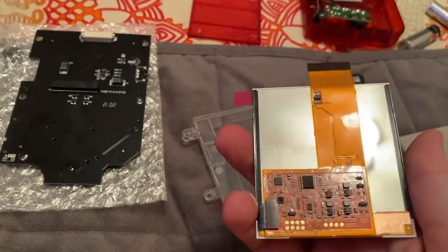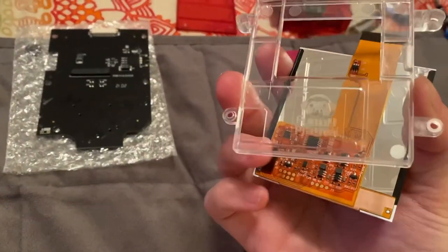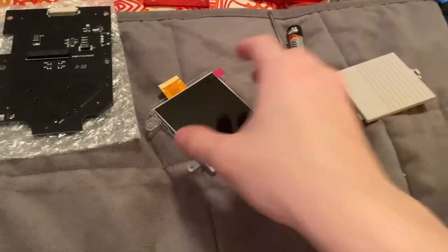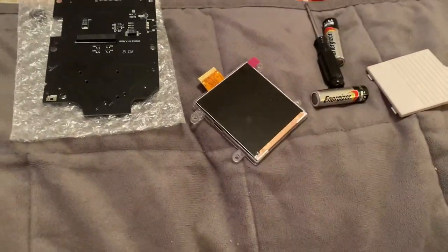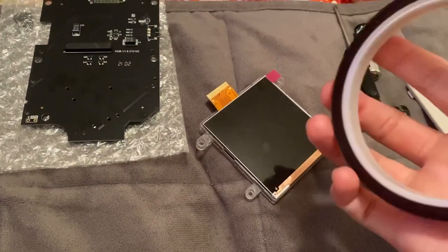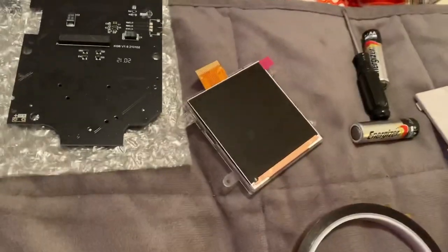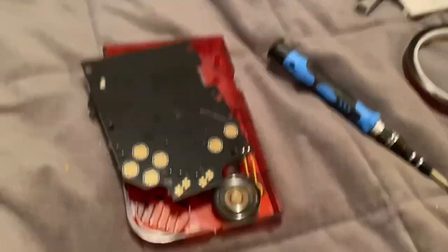I am starting to put together the screen. I also brought out my bracket for my screen so that it's ready to be seated. This little piece is already connected to the motherboard. I want to make sure I put some Kapton tape — that's the heat-resistant tape — so it doesn't short the chips to anything on this ribbon cable and also the board itself.